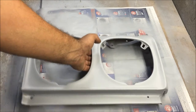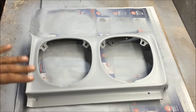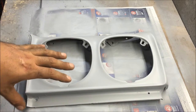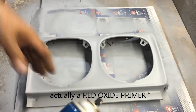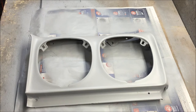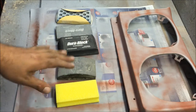Now that we have about two coats of primer on here, the first thing I do in the identification process is spray a guide coat on here. For the guide coat, you need to study that on your own — this isn't a guide coat video — but there are several different types. I just use a paint that I know for 10 to 15 years does not react to the primer I use.